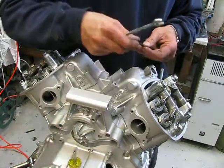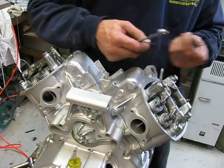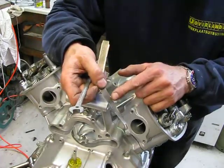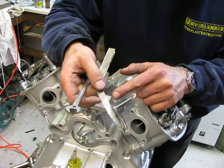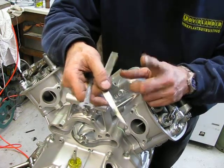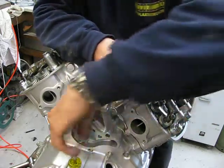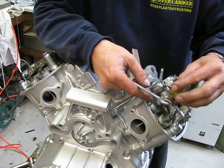When you put a new gasket in, you always have to readjust valve clearance. The feeler gauge is 0.08mm — it's very thin. You can cut yourself with it if you like, but I'm not ready to die this day.